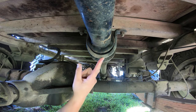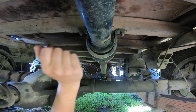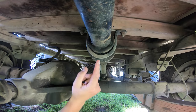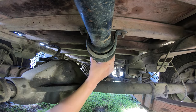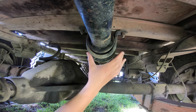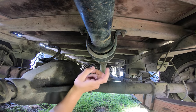What normally goes in these is a centre bearing — we replaced this about 12 months ago. The camera is magneted to this shaft but I can move it around a bit and there's no real play in that. But when I got to this one, we've got a problem. Normally the Cardan joint goes in these, but this flange here is moving and it should not be.